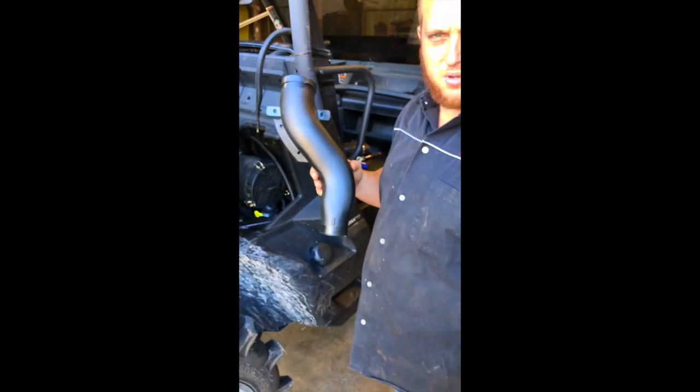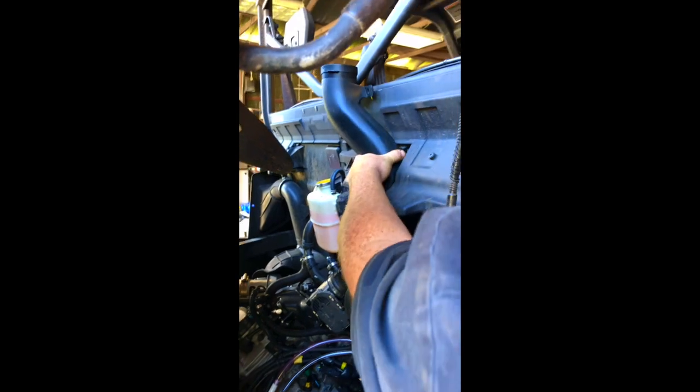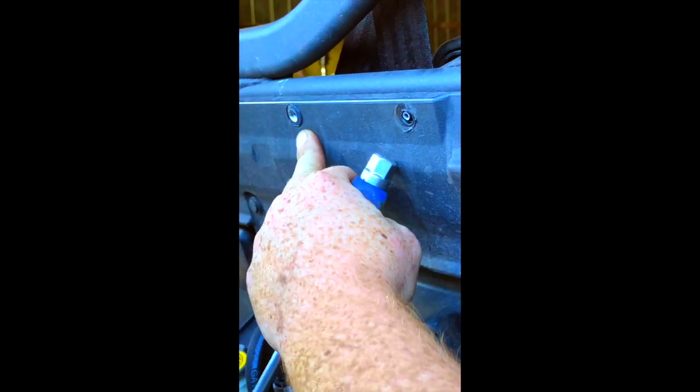This is the next piece of the kit to install. As you can see if you just fit it up, it's going to sit on these two rivets, so we'll have to drill those out. Weaken the rivet by drilling with a bigger size drill bit, and then you can hit the head with a flat head and a hammer to pop it off.